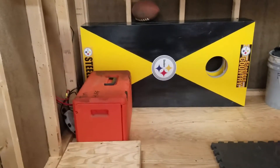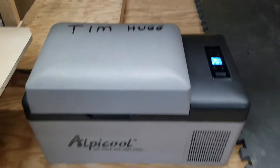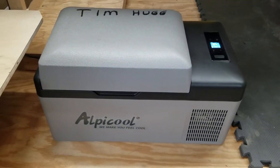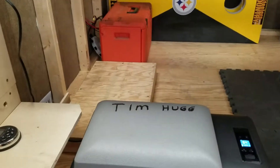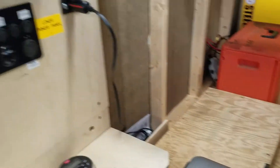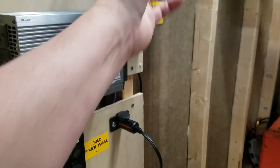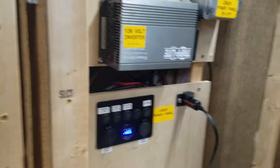I've got a three-battery setup in that box and a two-battery setup in this box with a two-bank charger, and they're independent. Because I bought one of these little Alpicool refrigerators to put my beer — I mean, soda — in, and it runs on its own socket that supplies that one only. This is our 12-volt system with the charge controllers. There's another charge controller in the back that charges that bank, and we put an inverter in it.